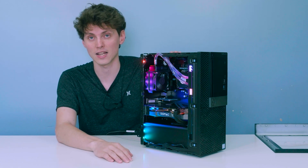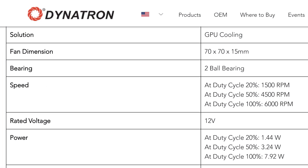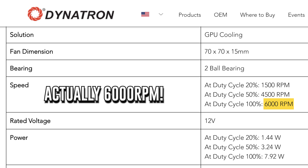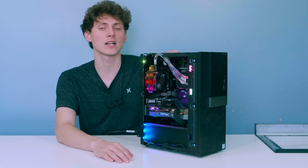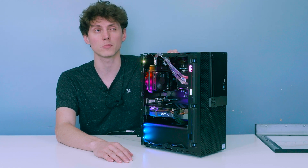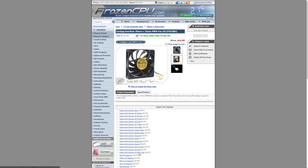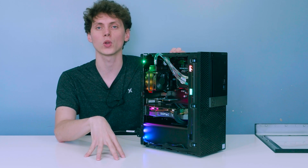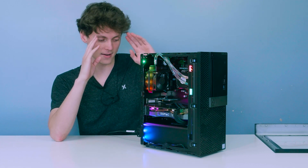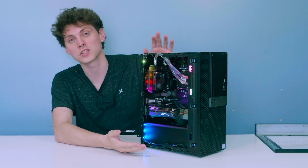Another issue: the fan bundled with the L6R1 ran at 5000 RPM and sounded like a hair dryer, so I needed replacement fans. I found a 70mm, 15mm-thick fan from Evercool. Finding a four-pin PWM 70mm fan was also difficult — most were three-pin — but I found one on Frozen CPU. After that, everything came together cleanly, and this is the final product you see now.